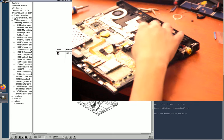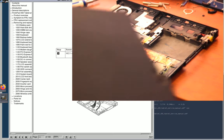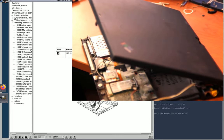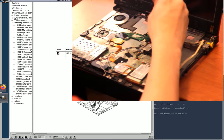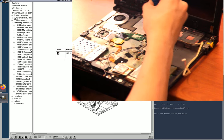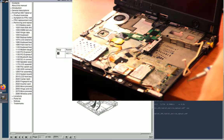And I'm keeping the chassis the same, so. Oops. Now I just have to remove the lid from the X60 the rest of the way. I already got started on that by removing those two rear screws and unrouting most of this. So let's get to the LCD cable now, or the LCD bridge board. The hard cable, let's call it, or I'm calling it.